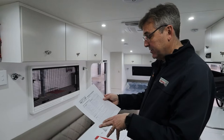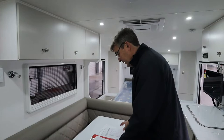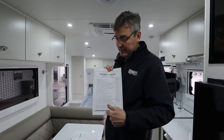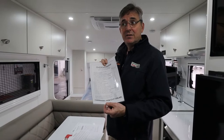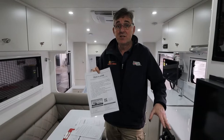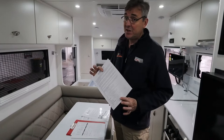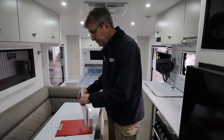Pin two will do different things on different caravans, and pins eight to twelve will do different things on different caravans, so it's important to know what you need and what you've got. We also isolate where different bits and pieces are so you can find them - in this caravan's case the battery and charging system are under the couch, so if you're going to put in more batteries you can have a look and plan accordingly. We also like to give you a nice little check sheet: what to do when you get somewhere, and what to do when you pack up - a much bigger list because you've got to remember your hoses, cords, TV antenna, and all the little stuff. If you go through the list you won't be asking as you drive off whether the antenna's down or if you've still got something hooked in. When in doubt, ring us - we keep photos of the van so we can almost guide you through it.